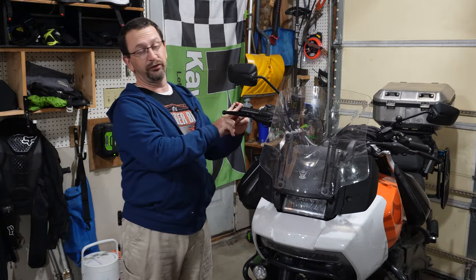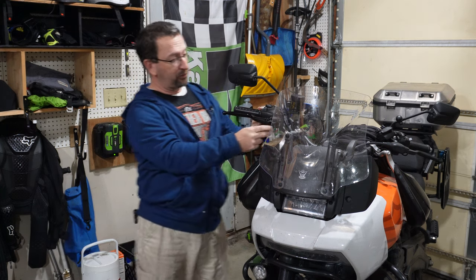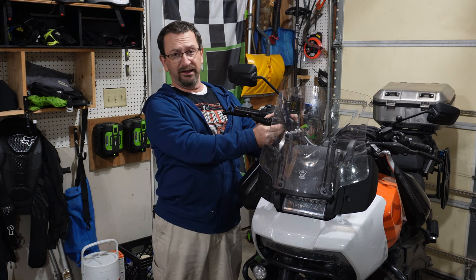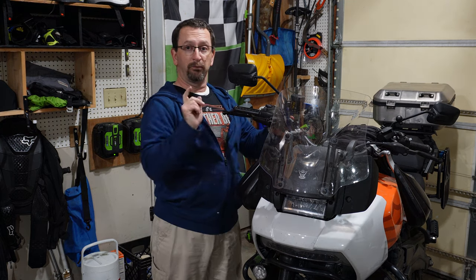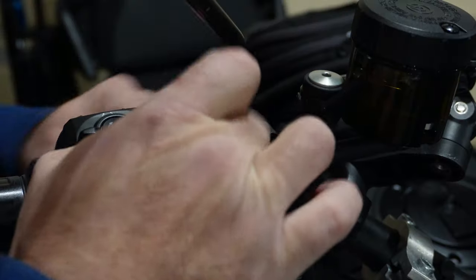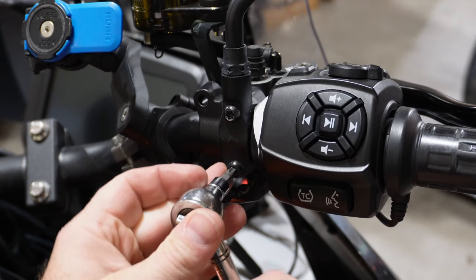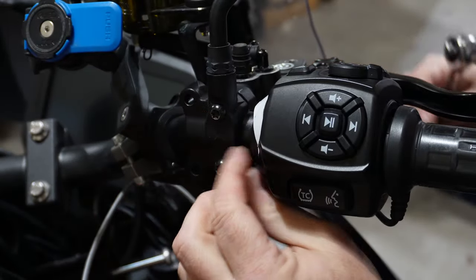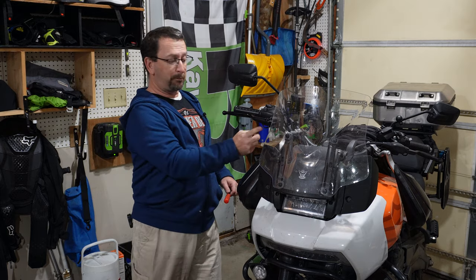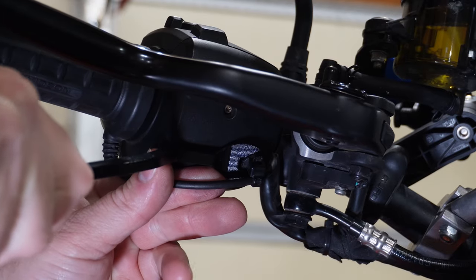The throttle side is a little different. We do still need to pull off the bar end, but there is no clamp holding the grip to the bar. The front brake master cylinder gets in the way a bit, making it a challenge to remove and reinstall the back cover of this control module, so we need to move it. Before we do, I recommend using a piece of tape to mark the alignment so that when you reinstall it, your brake lever angle is exactly the same. Once you have that mark, loosen the two T30 bolts that secure it — don't pull them out all the way, just loosen enough to slide the assembly over about a quarter of an inch. This side also has a wire clip on the back cover that I recommend pulling out before removing those two T10 screws.